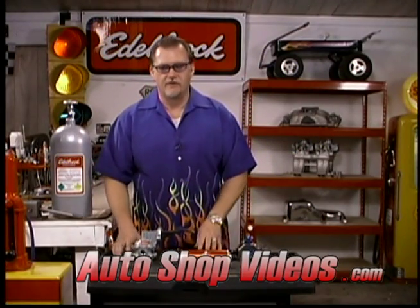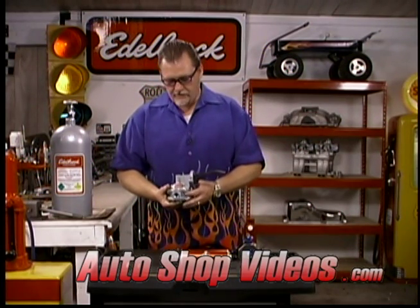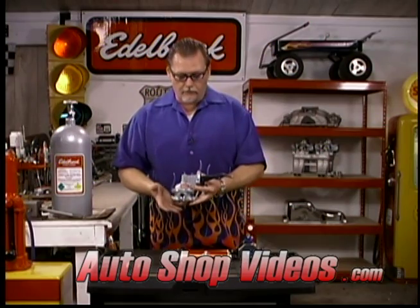So let's take a look at different fuel pumps and different fittings and regulators and stuff. Most muscle cars and V8s, American V8s and stuff like that, run a mechanical fuel pump. Can you run a mechanical fuel pump with nitrous? Sure, especially if it's under a 150 or 200 horsepower shot, of course. The trick is, though, you're going to need a good high-flow pump.